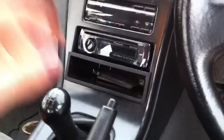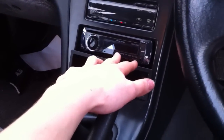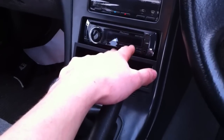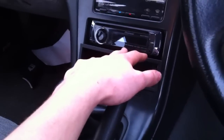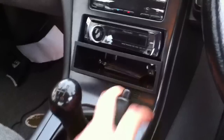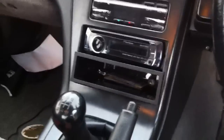But now, since I have an aftermarket deck, there's no antenna wire on here — it's just a remote wire. So when you turn on even the CD player, it'll put your aerial up. It's a really ugly freaking aerial. It's massive — like a metre long — on a really small car. It looks shocking.